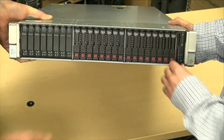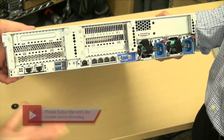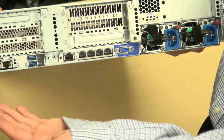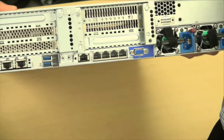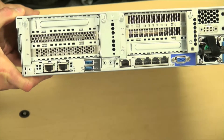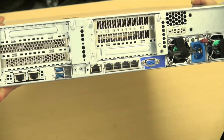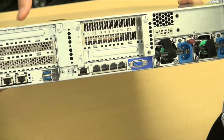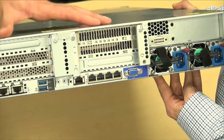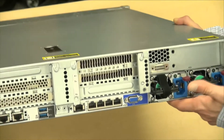Let's take a look around the back. We've got two power supplies — normal redundant power — and then a bucket of network ports. In this particular configuration, these are our two 10-gig ports, though it's configurable; customers could get 1-gig ports as well, for possibly a remote branch office. We also have ILO and then various factory and installation ports. And then we've got the usual collection of expansion slots — being a 2U enclosure, you get plenty of expansion. Let's take a look inside and see what's in those expansion bays.